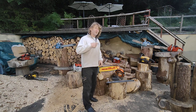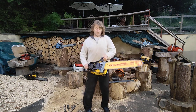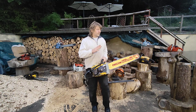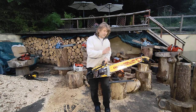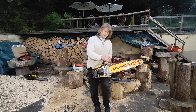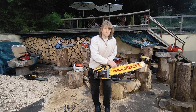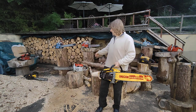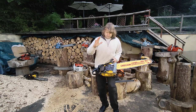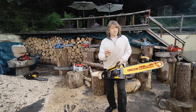So the Alpina 70, and then for the next 10 or 12 years, from 68 up to 80, they started to make some amazing additions to that range. This is one of them. This is the iconic A90. Nominal 90cc, just over. So these run a 54mm piston and an unusual 39.1 stroke, just over, the Stihl 050 and 051 behind, 89cc, that's a 52-42, and double felling spikes. So some of these saws share some really interesting similarities.